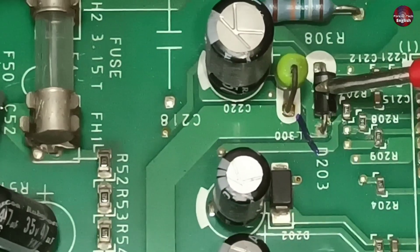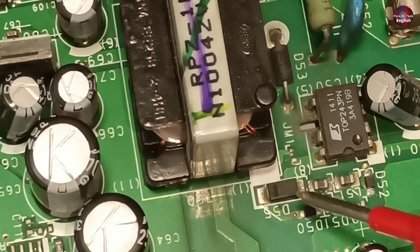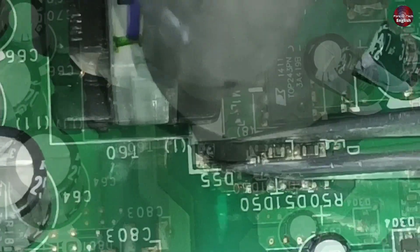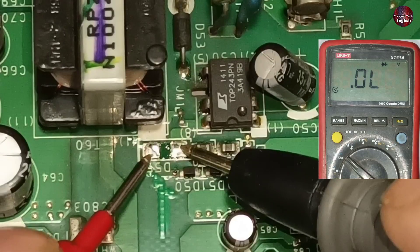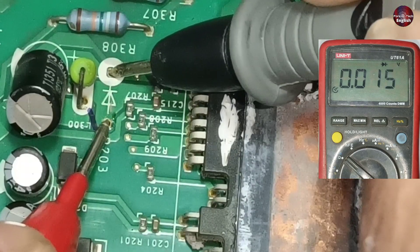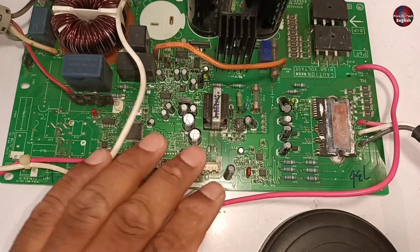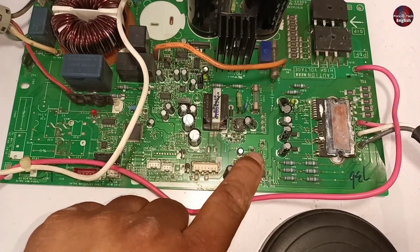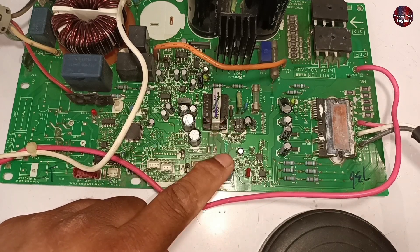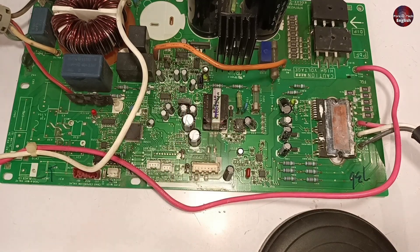Every component which passes 15 volts is showing a problem. I will remove this diode to understand where the short circuit is present. After removing the diode, the pads are still short circuit. The recovery diode pads are also showing short after I removed the diode. The 15 volts flow across the motherboard, and minus 12 volts are also present. I will have to find which component in this motherboard is causing the short circuit — I will check it off camera and then tell you.